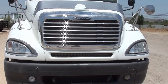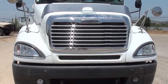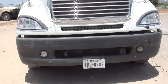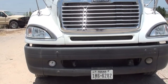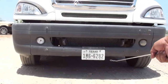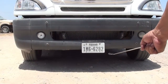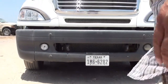From there, you're going to stay right here and check the suspension: not leaning to the left or to the right, which would indicate suspension problems or a low or flat tire. You're going to look under the hood, under the motor, and see that there are no puddles of oil, water cooling, or power steering fluid, which is an indication that you have a leak. We need to fix it before we leave. Then from here, you're going to open the motor.